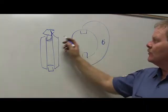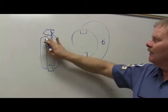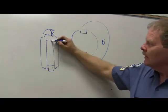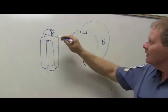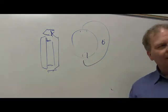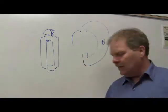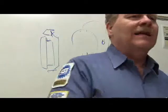This one here, these were worn completely off of it. There was nothing there. These were gone. You had this, you had that, and you had the fork. So these weren't even in there. And he could not put it in gear. This would just go past that sleeve. How did they get gone? Scrubbing the gear? It was in high gear.